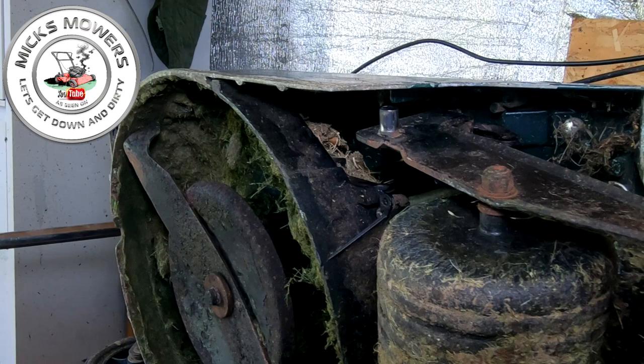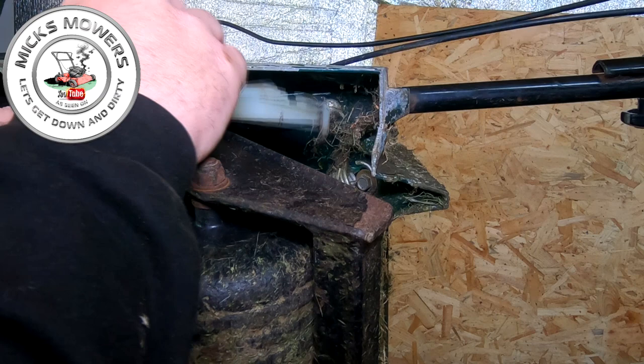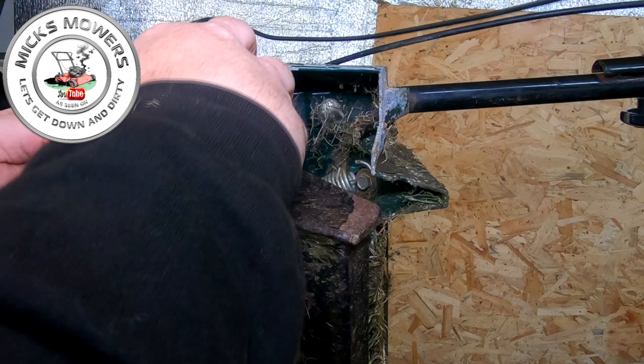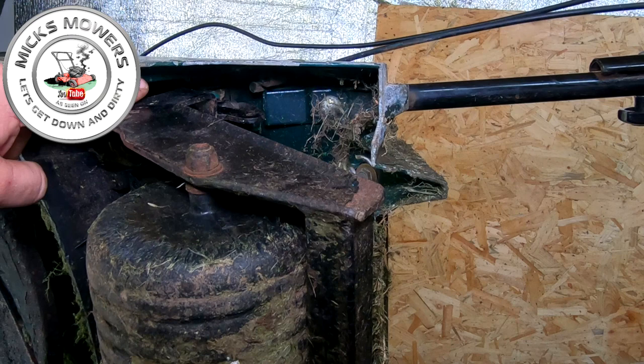And then to reinstall this roller, all you need is this white piece, which sits onto this rod here via this piece here. So slide it into place first. Once that's into place, like so, there's a little tiny, let me show you it. There's a little tiny groove that this sits in, where there's gaps in here, just here, okay? You can't miss it. So that's got to go up inside that groove like so.